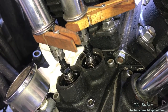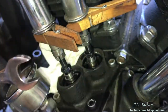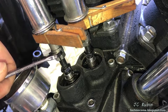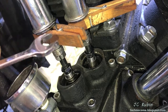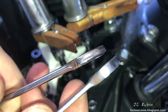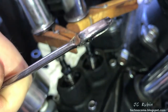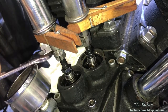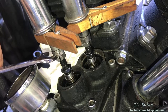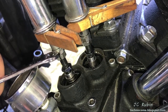I'll rotate it all the way down — there we go, that's a good starting point. I'll point out that there's not a whole lot of room to work here, so I recommend getting a set of half-profile wrenches. From Cobalt in my case — you can see the considerable difference between a standard and a half-profile; this is the only one that's really going to fit and allow you to get to the lock nut. You can see this lock nut has a split in it, and this is what we need to loosen first in order to shorten the push rod for removal.